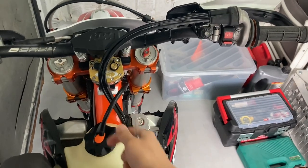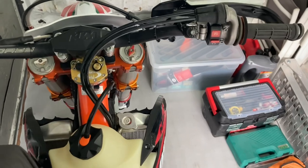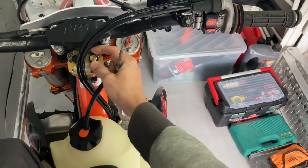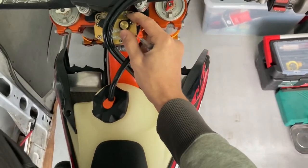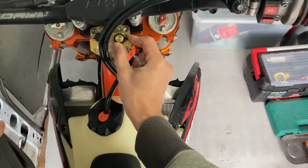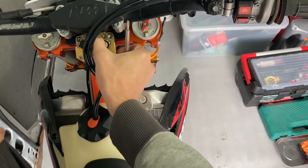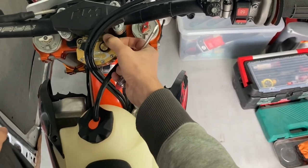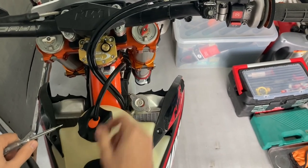Now why is the Scott's damper the best steering damper on the market? It's the only one that has both high-speed and low-speed adjustability. These are basically two dials on the steering damper — turning clockwise gives a harder setting, and turning anti-clockwise gives a softer setting.